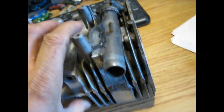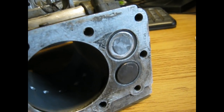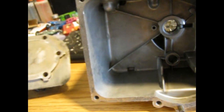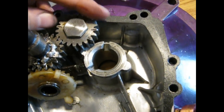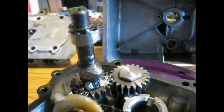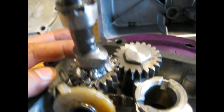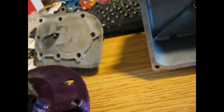On the exhaust side, the intake valve is still there but I've ground it down flush and will have silicone seal on top of it. The exhaust valve is still used for exhaust, though this is a two-stroke engine so it fires every time. To accomplish that I've gone with a full crankshaft speed camshaft drive. The crankshaft drives the camshaft one-to-one, in this case backwards. This was originally used for my poppet valve two-stroke so it has an intake lobe and an exhaust lobe, but the intake lobe won't be used since we have the intake ports in the block. I try to reuse components as much as I can since they're difficult to build.